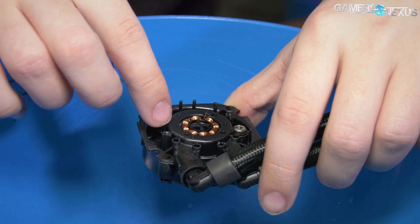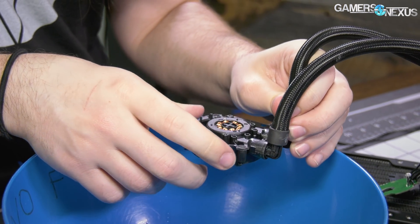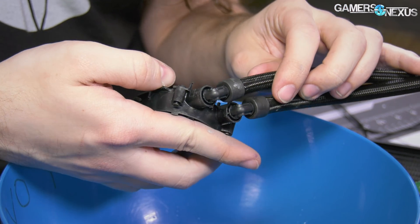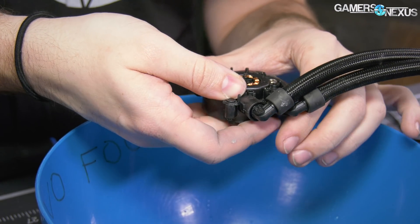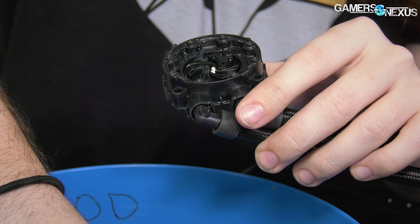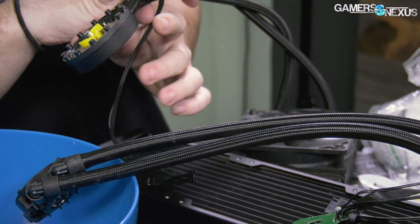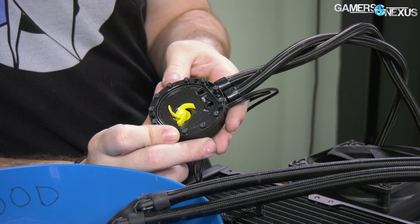Here's the electromagnet, and here are your in and out valves. From the top with tubes oriented toward the top of the motherboard, liquid comes in through the right tube and out through the left. Now we're getting to the stuff Asetek actually changed — this impeller is massively different. Let me grab an old one for comparison: this is from an EVGA cooler, a gen 4.5 pump, which actually has a faster impeller than gen 5.